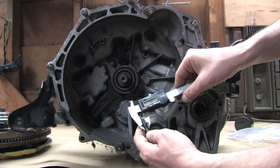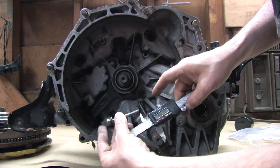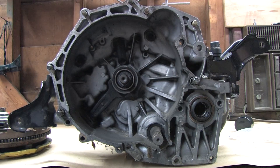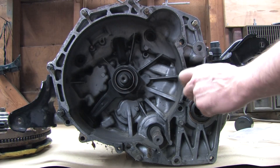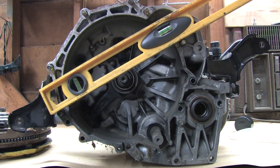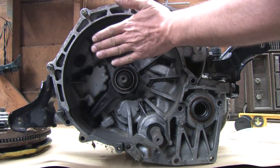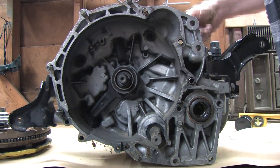This is the M8x60 bolt — roughly 8mm by 60mm — and this is the bolt that goes through this hole. In relation to where the input shaft is, you can see that when you have this bolt with both lower bolts in line, the input shaft rides above it. If this bolt, due to poor maintenance or oversight, is not in this hole, gets loose, or falls out, then the only bolt you have next in line is the starter bolt. If you take a straight edge and put it across there, look where that input shaft lines up below that point. That means if this bolt is not in place, automatically your clutch is going to engage and disengage crooked — it's going to apply all of its force on the top side. Because the transmission, by its nature, when it forces its force against the clutch, is going to rock the lower portion of it away from the block, even if all of the other bolts are tight.